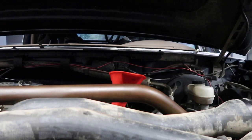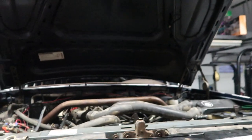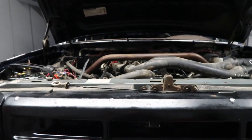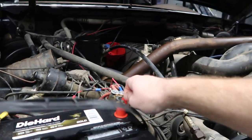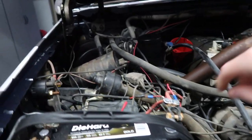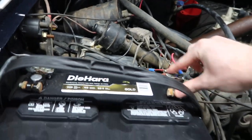I'm gonna do it anyway — I gotta cut the roof off and do a bunch of stuff. Definitely not my proudest moment. We're gonna throw some power steering fluid in there off camera. Motor oil is in, trans fluid is in — just one gallon so far. Gonna start it up. I gotta connect the battery — fresh battery. Power steering fluid is in. I'm just gonna let it run for a second and see what it does, because I think I'm gonna need to add more trans fluid and more power steering fluid once it cycles through the system.